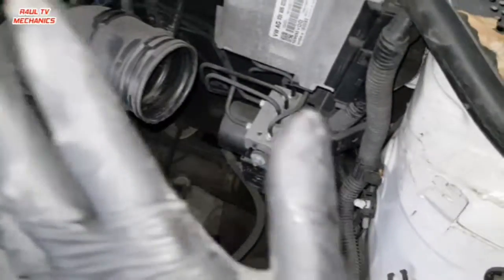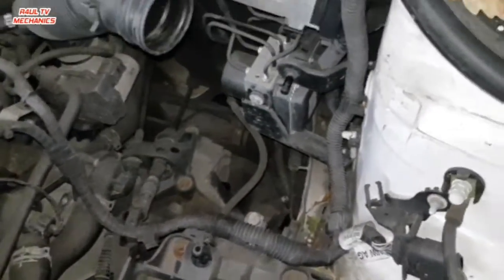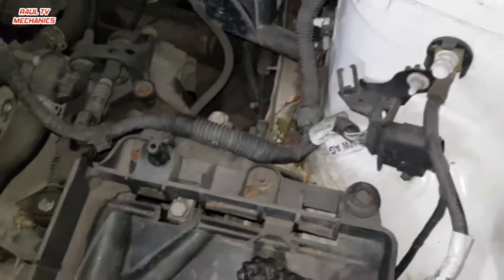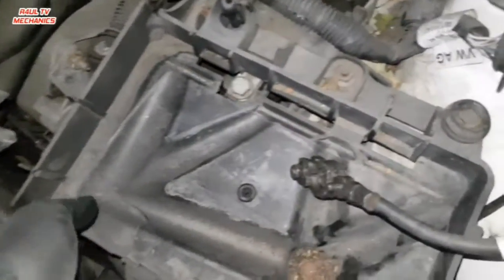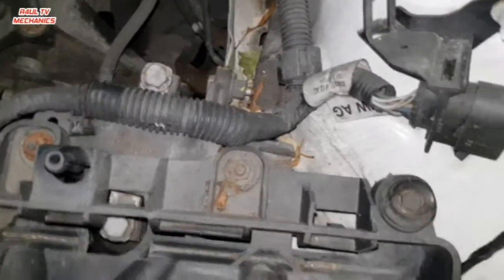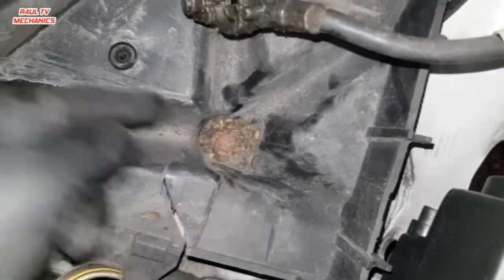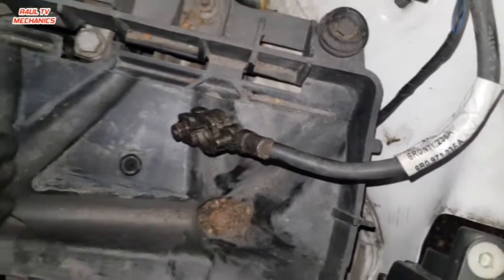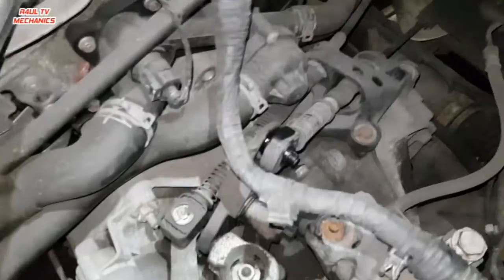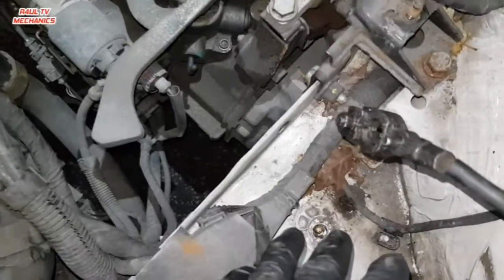As you can see, I've taken the air filter box off, the battery's off. If the radio's coded, make sure you know the radio code. In any case, it has to come off, Sod's law. What we're going to do is take this off, this off, this off, all 13 millis, take them three off. This tray should just come off, and then we can gain access to the bell housing, the starter, the linkage cables, everything. Right, battery tray is out of the way.